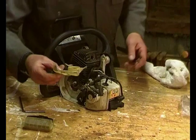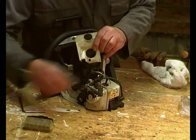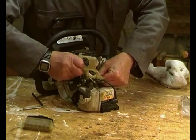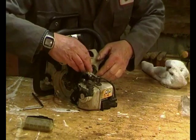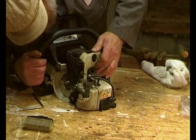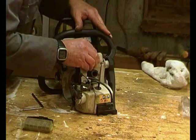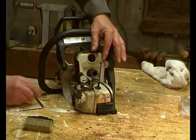Now we've got to put this heat shield in place. There's a little hole down here, just down there. That's where the vacuum pipe comes through. And if you don't get it in place, again, you have to strip half of it down again. How it fits is a bit counterintuitive, so you have to just work out when it's right. There we go.